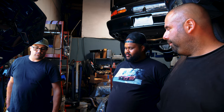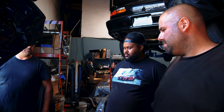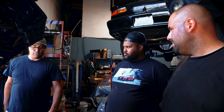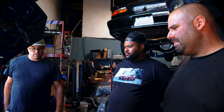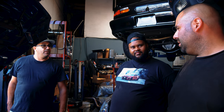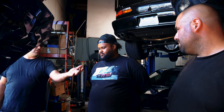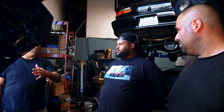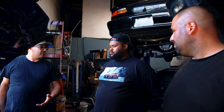The mass airflow sensor is before the blower, so basically this thing isn't even seeing boost — you're guessing. You're all off the map sensor. See how this is air here, and then you have boost behind the mass airflow? Pretend this is a big vacuum leak that you're trying to tune around. So if I get rid of this, I just leave it like that — it just sucks in there. If you really wanted to run a MAF in this application, you could do a couple of things. One is you can put an LS7-style MAF, it'll give you a little bit more range, but I don't like a draw-through setup. I've never tuned a car like this, to be honest. I've always tuned what goes into the engine, because what you see here is not what you see there. You have losses through the intercooler core, and you can have a boost leak — different things that will impact how this reads.